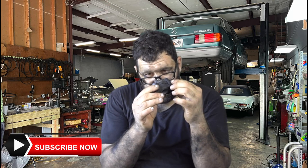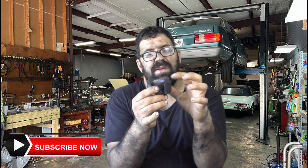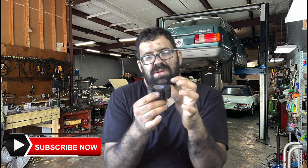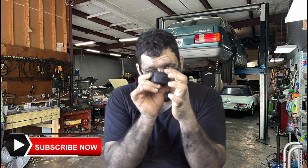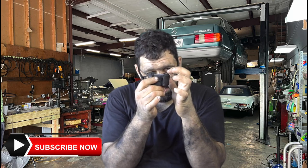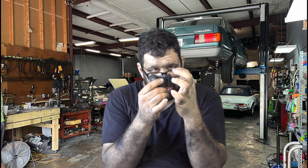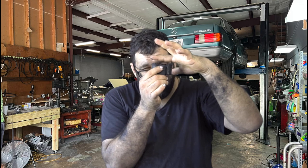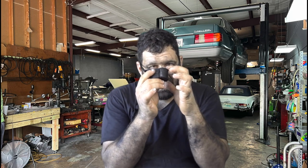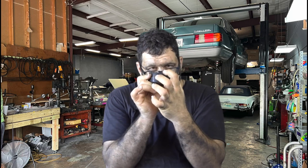What we're looking at is a cheap, collapsed, old Febi mount. If your subframe mount looks like this where the center is lower, this is the wear indicator — focus on this. Your center should be even with or higher than the wear indicator. If it's lower than the wear indicator, which should face outside, the subframe mount is junk and you're in trouble.